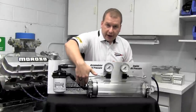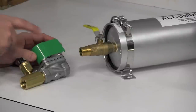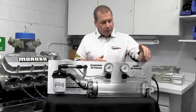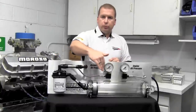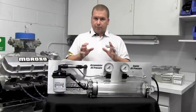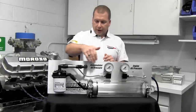Typically there is an on-off valve that comes with these. There's either an on-off valve or the Moroso 23905 electric solenoid, which hooks up to your ignition system. You can either activate this manually or by turning on your ignition or a preset switch in your car. Now that we've set this up with our accumulator pressure gauge — showing exactly what the accumulator is creating into the engine — and our engine oil pressure gauge, let's start this car up.